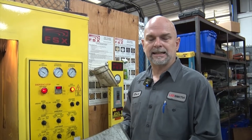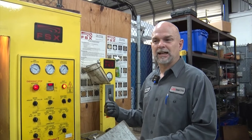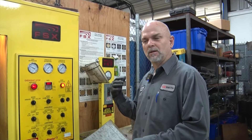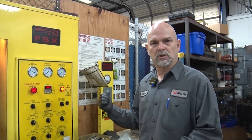Just like anything else, keep your records up and know when you service the filter. But sometimes if you let it go too long, they get real packed in there and you got to put it in the kiln to break it up. It'll break up the soot, then you put it back in, clean it, and it should be in specs. That ought to increase your life of the filter.